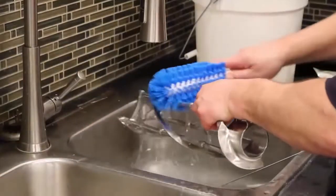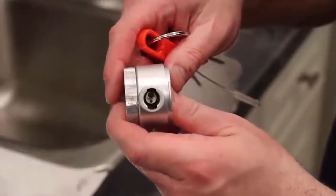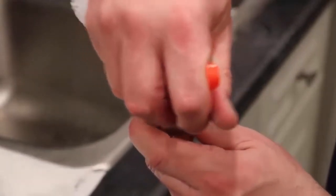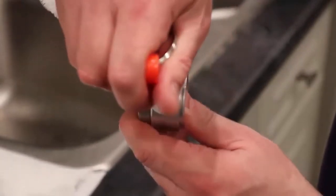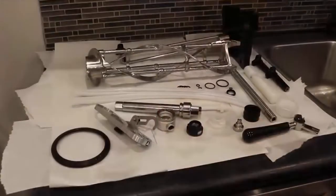Big parts, like the beater frame assembly, are easy to scrub. But pay special attention to the holes on the injector head. Using a tiny brush, ensure these holes are clear. Syrup can build up preventing any flavor burst mix from dispensing with your product.